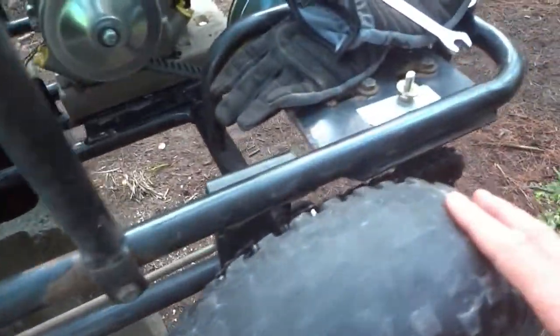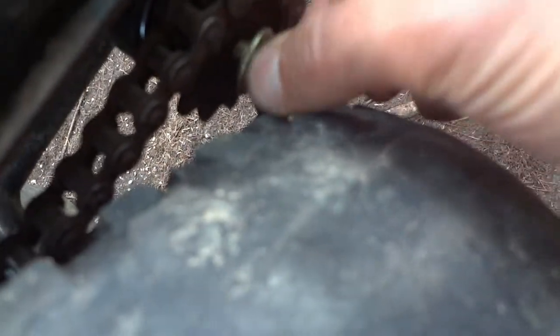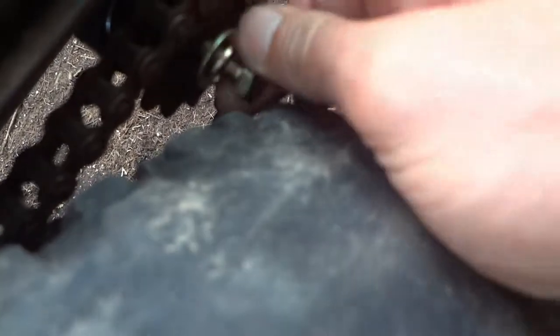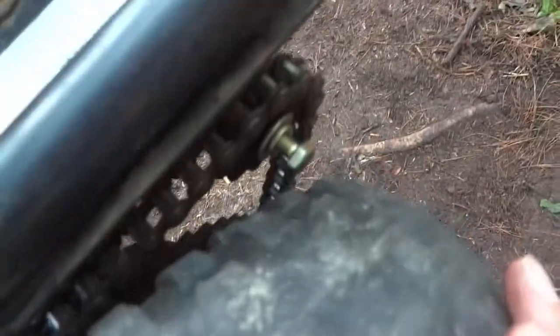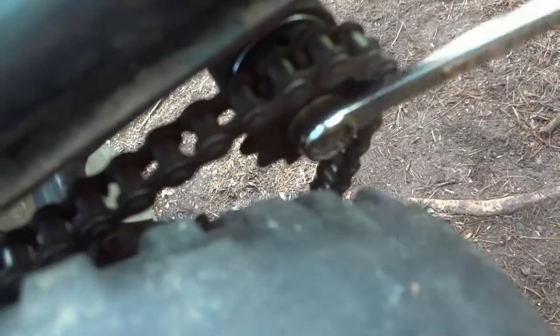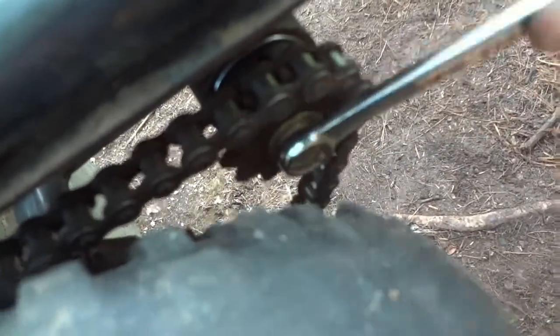All right, things are getting tightened down. But I will comment on something here. This jack shaft I had to get. I'm not sure if you're able to see this with the light or not. But if I put the bolt in, I just start to feather it in. It becomes obvious here that the holes on this jack shaft are not centered. You can see that, so threads in just fine, it'll hold just fine, but whoever lined this one up in China probably lined it up freehand, so very well.